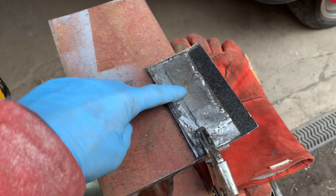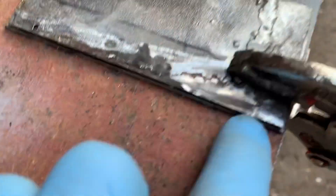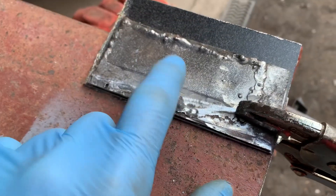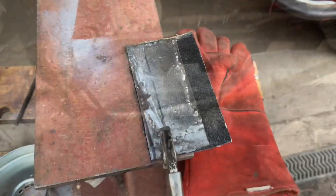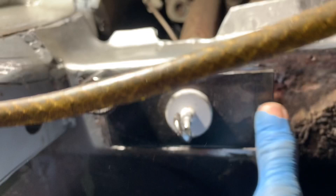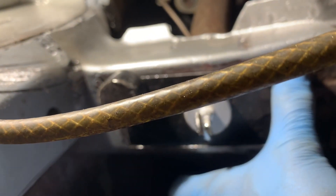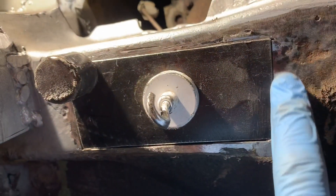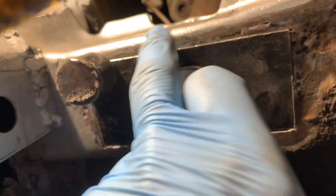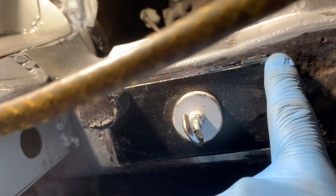What I'm going to do is clamp the piece we've cut out over this piece here so we get a pretty much exact fit, making the piece we're going to put in there slightly bigger than this — the width of the cut will have made it slightly smaller. It's a pretty much perfect fit in there, and we're just going to tack it in and then tap it with a hammer if needed. The metal here is thinner so we've got to be very careful when we come to grind the welds down. Really it's only the top welds that need to be flat here because this is where the panel lip will be sitting — we've got to make sure that's watertight and has good penetration.